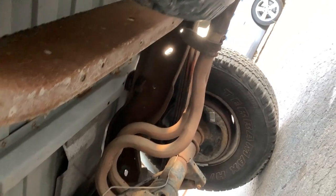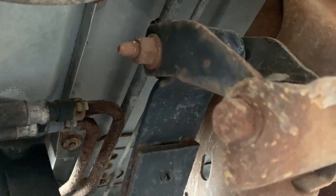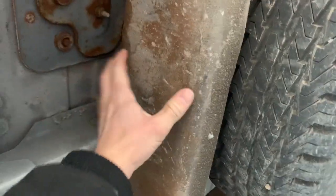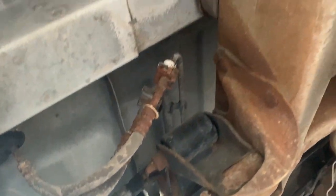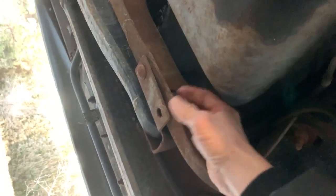It's got big leaf springs. When I do the driveshaft and U-joints, I'm going to drop the whole differential down, put new shocks on it, clean up the leaf springs, put new bushings, and possibly do the rear bearings as well. I'm also putting a five-gallon diesel tank right here attached to the frame rail for the diesel heater — I'll customize it with a fitting that goes up to the bumper surface so I can fill it easily. There's also a broken rivet on the front left I-beam that I'll replace with a bolt.